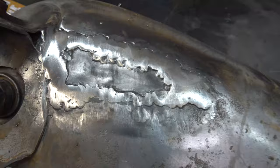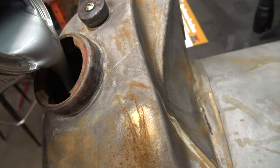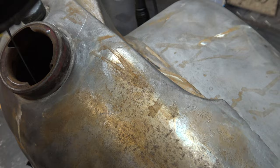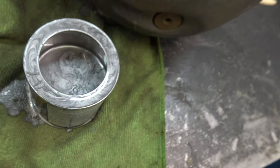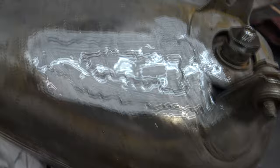I wire-wheeled this weld area because when we're done sealing the inside, I'm going to be painting the outside of the weld area with this stuff. Got her all mixed up — in she goes. Putting the cap on, I've got to rotate this tank around for like a half hour now to try to get it all through the inside and cover every surface. I probably got about half of everything I put in there out. It's supposed to be a thin coat — they don't want air bubbles in it. These guys do have a product for actually stripping this stuff out too, which is interesting. So if you get a tank that has a failed liner, apparently you can strip it out. I painted up that whole weld area.